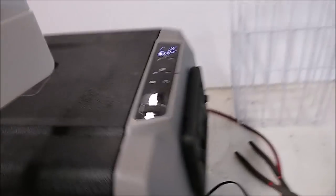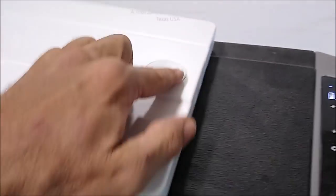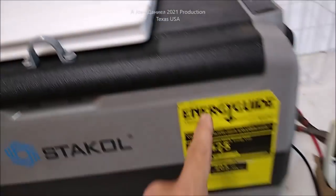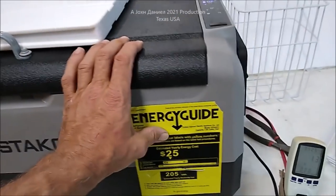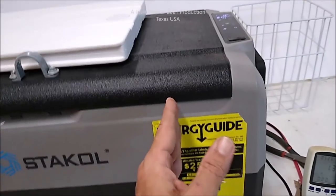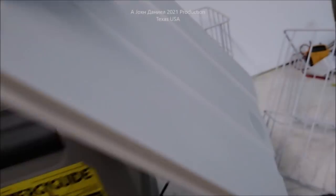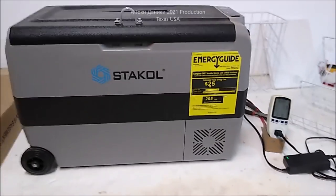These are the baskets that go in it. This is the special item — these two separate features are two zones. You see this little disc plug here — there's a sensor inside that when it's down in the center it allows a refrigerator-and-freezer effect. The refrigerator side will be about 45 degrees and the freezer side will be roughly 15 degrees or less — about a 30-degree difference. For an RV or camper, with a couple of 100-watt solar panels and one or two deep-cycle batteries, you can run this day and night; 3 amps is nothing.